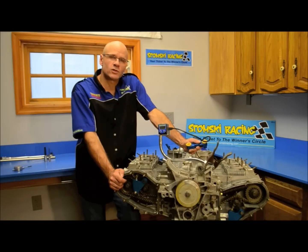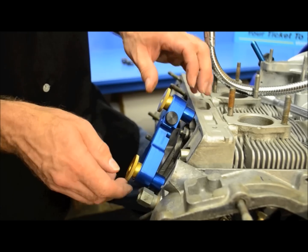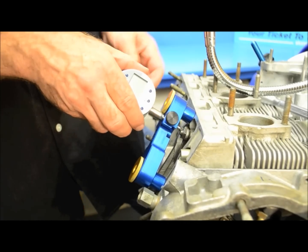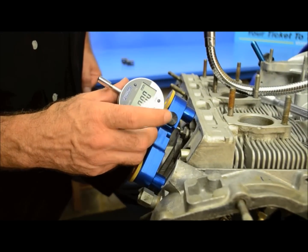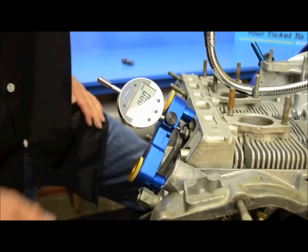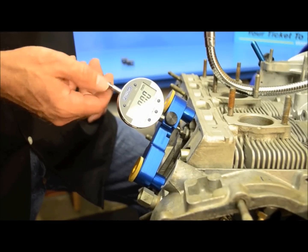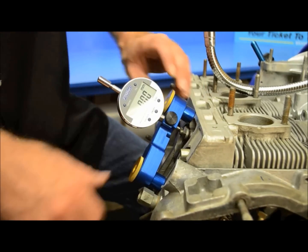The first step now is we're actually going to set the SR098 in place, and then from there we'll start to rotate the engine. You'll see how quickly the tool goes into place. Since it bridges over the two studs, it indexes and it's held in place predictably and constantly. Now we're good to go — that's how quickly it sets up. I'm going to zero out the indicator. We are at TDC Z1. I've locked down the thumb screws and made sure the gauge is secure. Since everything is indexed, the indicator foot goes down every time to the same spot on your valve spring retainer, so you don't have to worry about alignment or the thing slipping off. It's held in place dead on each time.